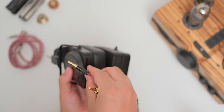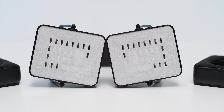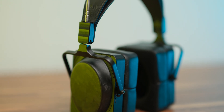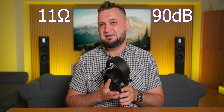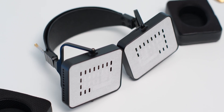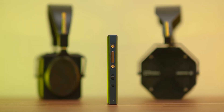If you are wondering what technology has been used, these are closed-back planar magnetic headphones that use one-of-a-kind drivers made in-house by Jeffrey of SJY Audio. There were more than 60 revisions until reaching a desirable tuning, and I'm actually testing the latest iteration right now. Perhaps what's not so good about these headphones is a very low impedance of 11 ohms and also a low sensitivity of 90 dB. So these are mostly current-driven headphones at 11 ohms impedance, as opposed to voltage-driven high-impedance dynamic headphones. Most USB dongles won't work with these, and the biggest majority of portable DAC amps and digital audio players also won't work that well with these.